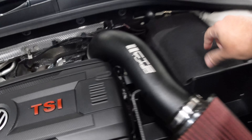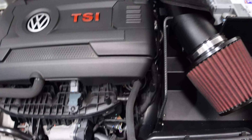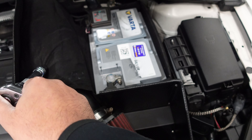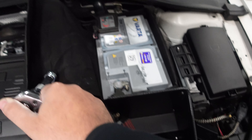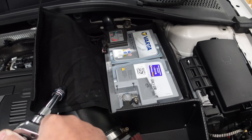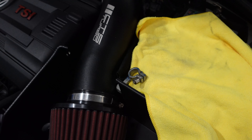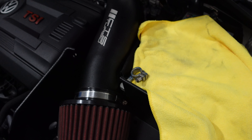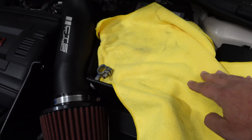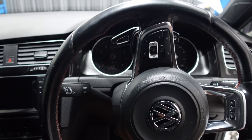As a disclaimer, make sure your battery is disconnected before you do anything. I always find it best to disconnect the positive terminal — I know a lot of people say to do the negative, but on these cars they've got something connected to the negative and I don't like messing with that. Being scared of electricity, I've taken a little bit longer than I should have. The terminal's not touching the battery at the moment — this is not conductive. If you don't see any more videos next week, you know what happened.